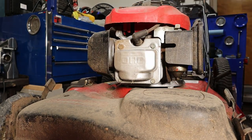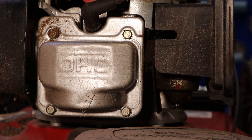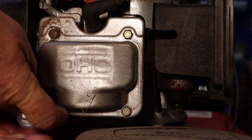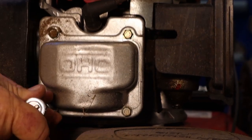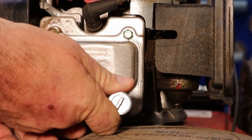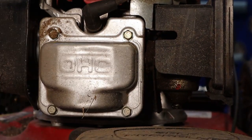It's not like we're gypping somebody on a service or something. Alright, that's the air filter — that's done. Let's take a look at our valves. Before we pull this off, we're going to blow this off a little bit just so we don't get quite as much junk down in our engine. Crack those loose — usually they're sealed on there and are really hard.